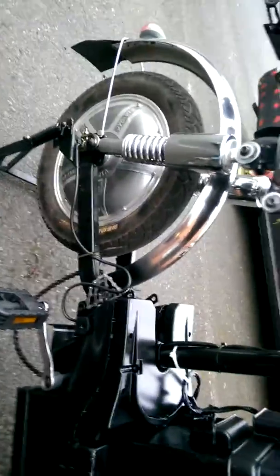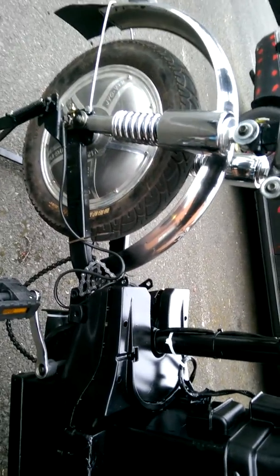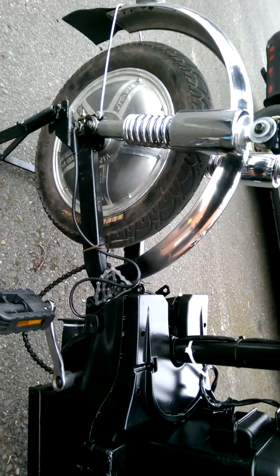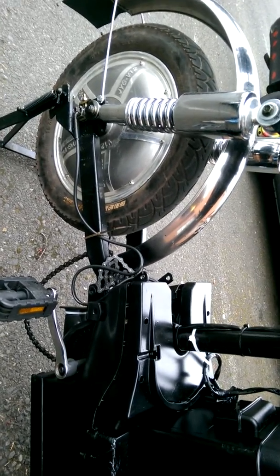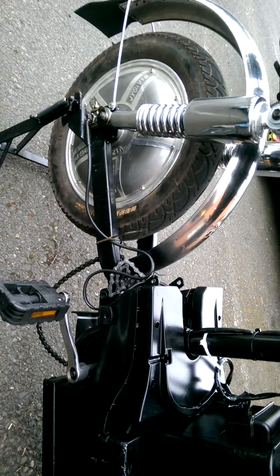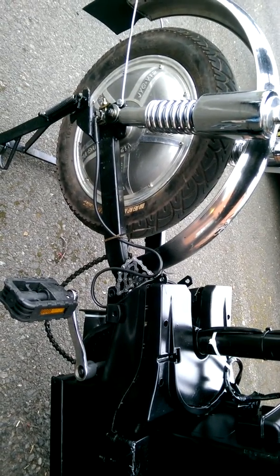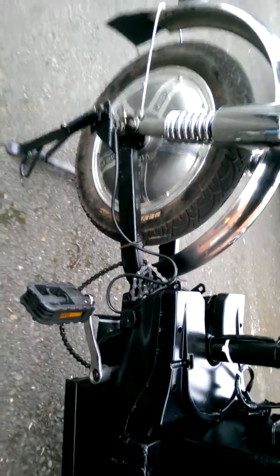The rear wheel used to have a 450-watt motor. Now it is a 1,000-watt motor. It was originally designed to run at 48 volts but has been upgraded to 60 volts at 25 amperes — that's 1,250 raw watts of maximum power consumption by the controller. Going out to the wheel it gives you about 1,000 watts to the ground — actual real brake wattage.